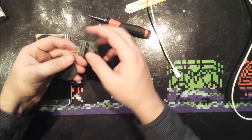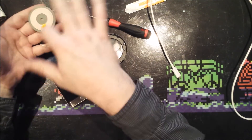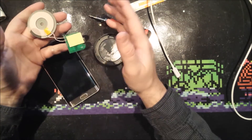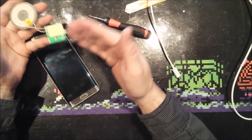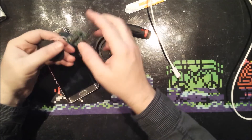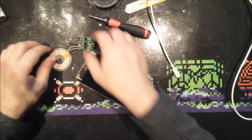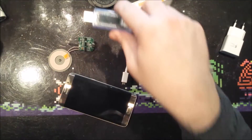The way it works is like this: when I put my phone on here, it detects the magnetic field and starts a kind of handshake — it says 'hey, I'm a phone,' and this part says 'I'm a charger.' Then they negotiate about the current this one can deliver and this one wants to take, and as soon as that is finished it starts the charge. That's in a nutshell how QI charging works. Let's see if it still works when it's outside of its box.